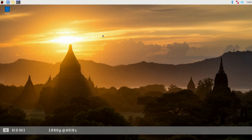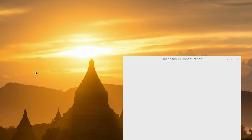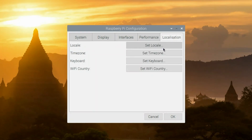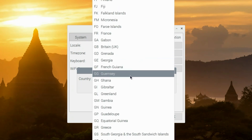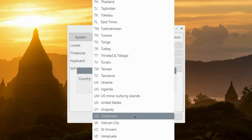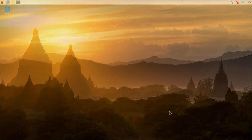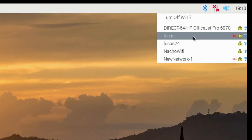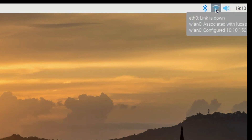Another setting you may want to make is to go into Raspberry Pi Configuration, then move to the Localization tab and set the Wi-Fi country. It defaults to China on this image; however I'm located in the USA, so I'll scroll down and select the United States. Click OK and then OK again. In the upper right-hand corner, go ahead and set your Wi-Fi — select your SSID and enter your passphrase, and shortly after it'll be connected to your Wi-Fi network.